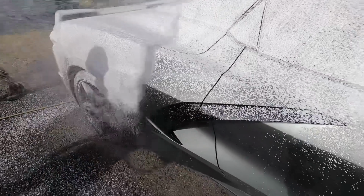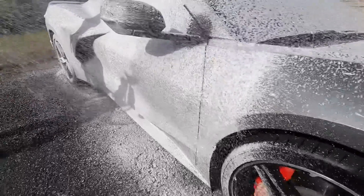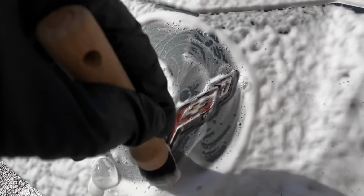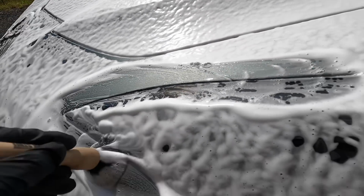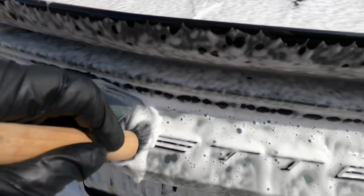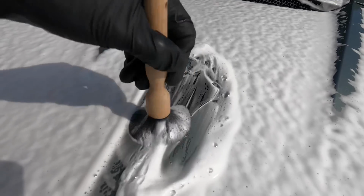And while we continue the wash process on this, let's get back to finishing the thought on shop floors. We've tried the Swiss Trax to the square tiles to the over-the-counter epoxy floors. Everything you can think of, we have tried. They have all failed rather quickly. The only way to go is the commercial grade epoxy floor with topper. I especially didn't like the Swiss Trax and anything like it doing the installs for PPF. They get wet and they get very, very slick and slippery that way.